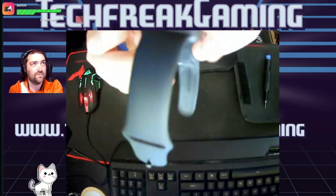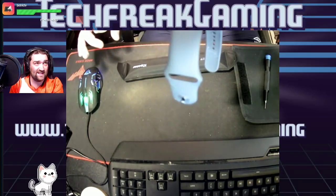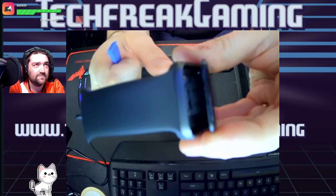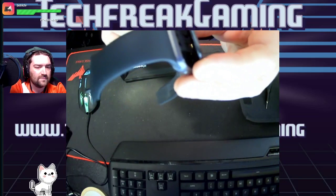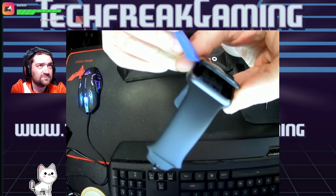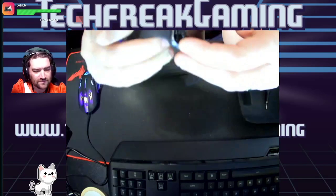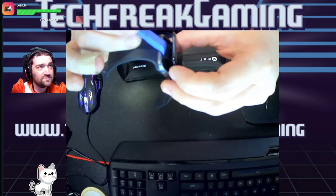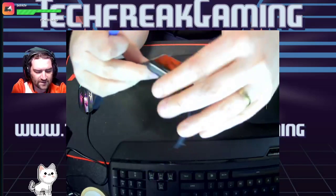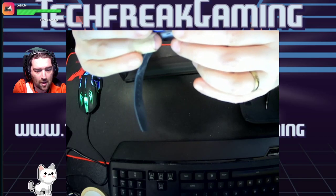As you can see, hopefully, I'm going to turn the lighting up a little bit. Let's go 100%. Sunlight! No. Yeah, so I don't know if you can see there. The adhesive is running around the actual bottom of the screen. The wiring loom is actually going along there as well. We want to be really careful with that because we don't want to wreck the pressure circuitry. So we're going to take our opening tool and we're just going to scoot around the edge.